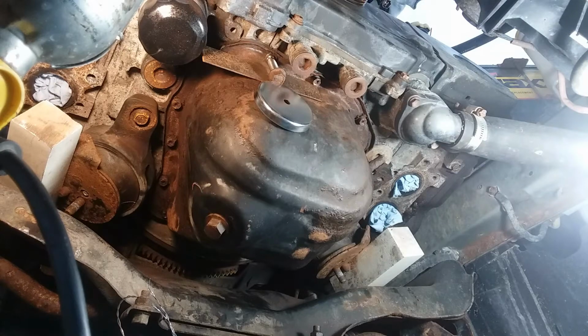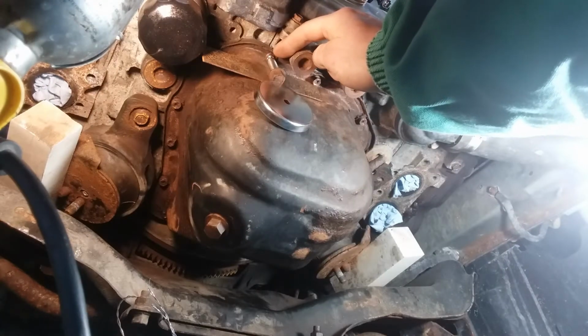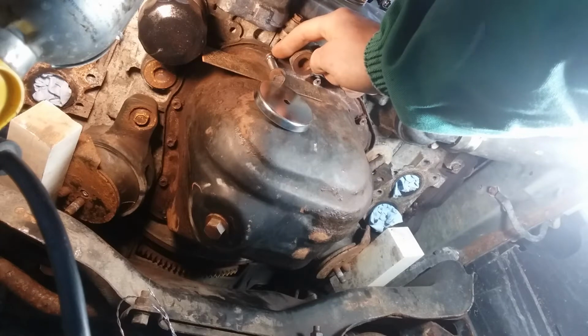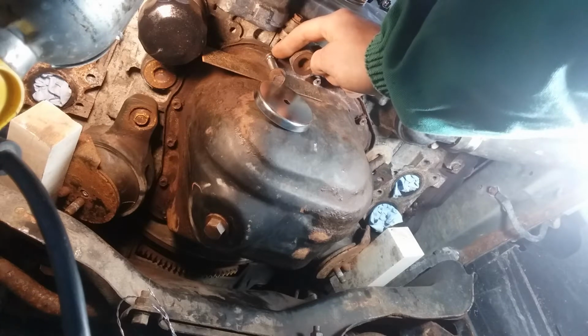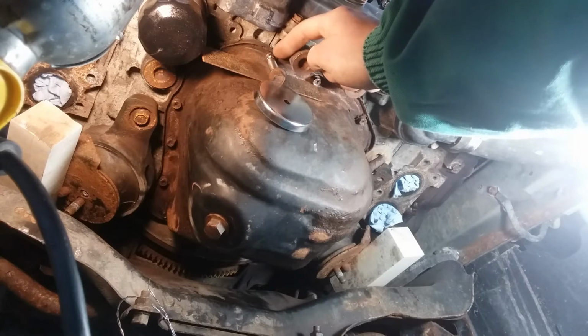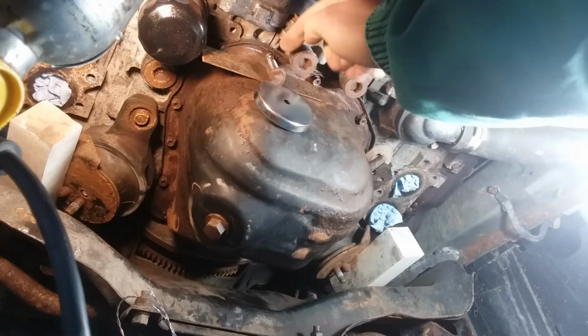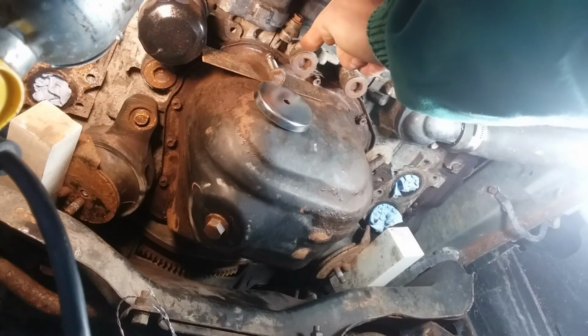Alright, here's what we got going on. The head of this bolt is chowdered. So I've cleaned and prepped that, and I've cleaned and prepped this sacrificial bolt. Then we're gonna try and fuse or tack weld together here so we can have a new fresh head and we can wind this out.